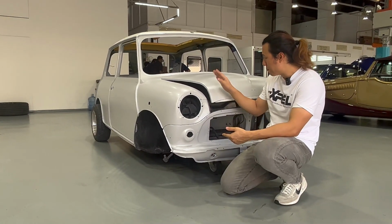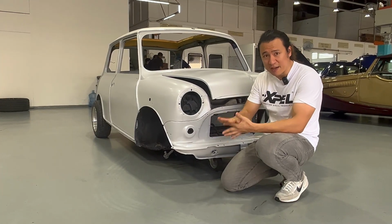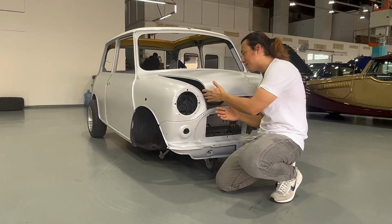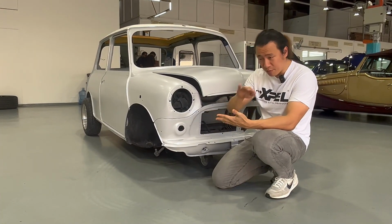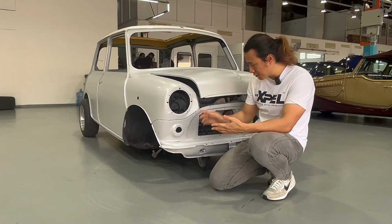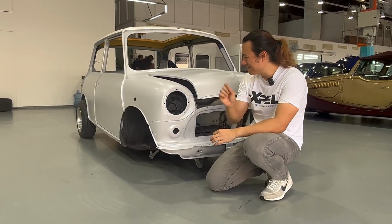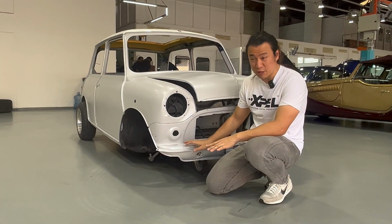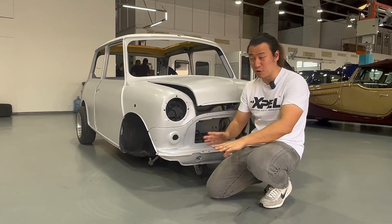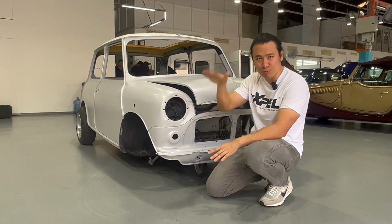get rid of the paint, your primer would be sprayed on top of the paint. Now, the problem about etching primer is that it's supposed to go onto the metal. So what's going to happen is that eventually over time it might peel off, or it will have a surface that's rough around these little edges. So it's just little things that you need to know when you want to strip everything down. Make sure all the paint is off. If you're going to take it off, take it all the way off. If you can't, at least sand it down to the paint and then spray primer on top of it.